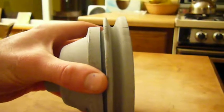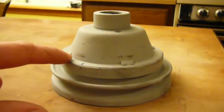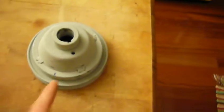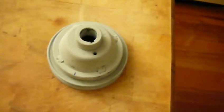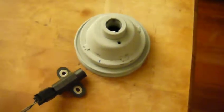We purchased this non-smog crank pulley for the 2002. The other day I cut up an old brake rotor and made this trim ring so that we can fit the trigger wheel in place. It fits on there with thermal expansion — we heat it up, slip it on, get alignment marks, and I fitted it on the engine to make sure there's a little sensor that measures what position the engine's at.